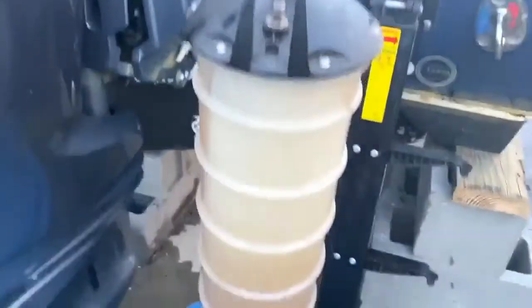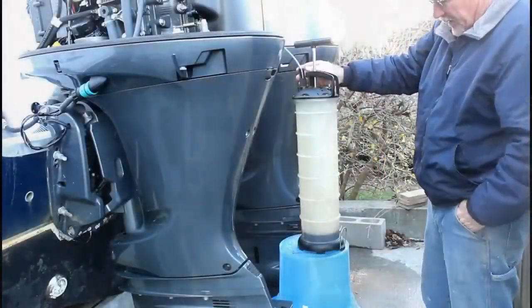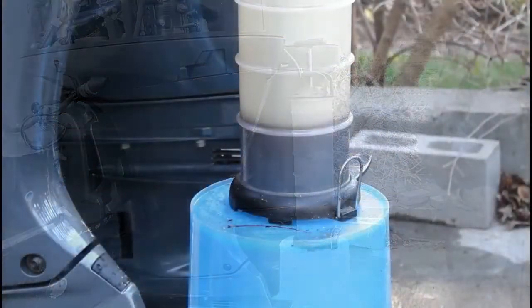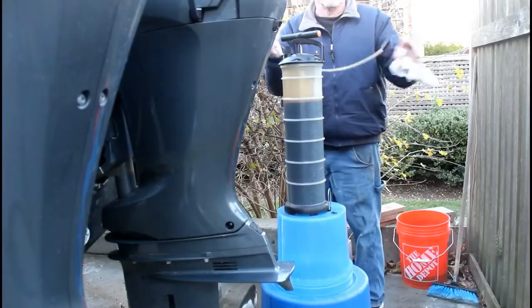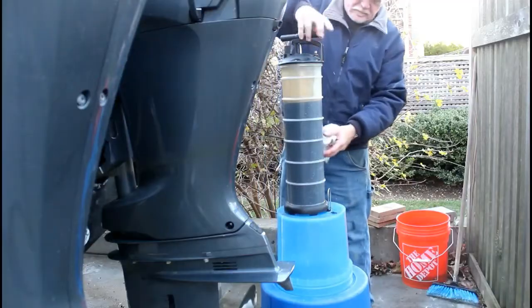This pump is a good one. You can pump oil out after warming up the engine and it comes out very easy. But with this pump you can actually pump out the oil even if you didn't warm up the engine. I got just over a gallon from each engine. It takes a little while. Once you get all the oil out, move the pump to the side.